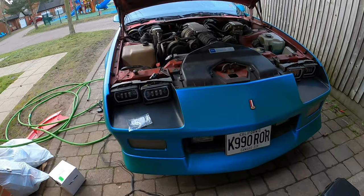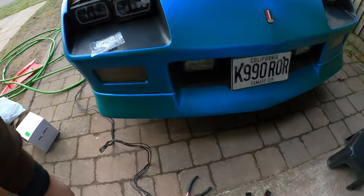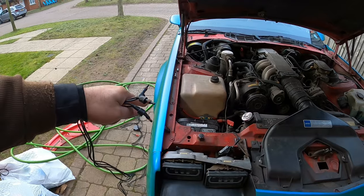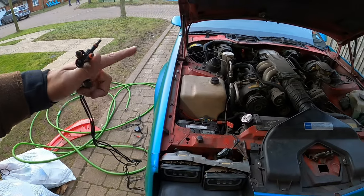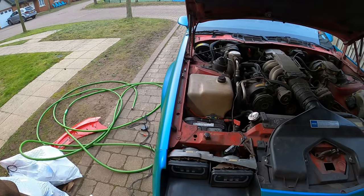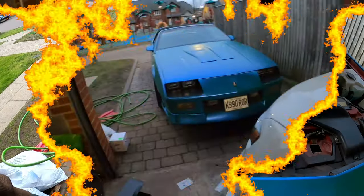All right, so I got all four of them in, plugged up — they all work. Now I'm about to connect the halo ring. It looks like it's all plug-and-play, so what I need to do is plug all four of these in to each one, then run and hide the wires. I'm gonna run the wire the same feed I did for the amp power, run it into the car, and connect the power and ground to the ignition switch so when you turn the car on the halos come on automatically. Then I can change the color whenever I want and turn them off whenever I want.